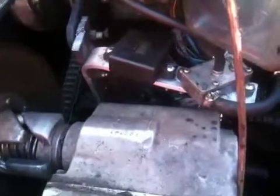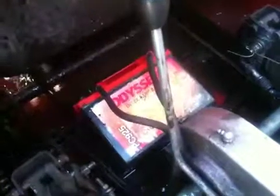Mounted my power pack, CDI box, and the fuel pump on there with my little electric outboard fuel pump. Put a fuel filter in there, regulators down in there. I got a dry cell Odyssey 12-volt battery I chucked in there. Made some labels for it.